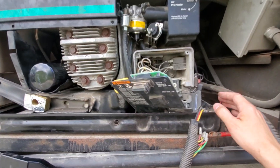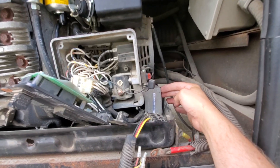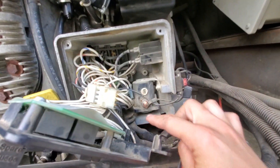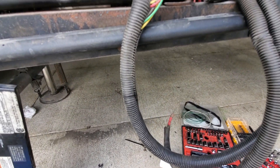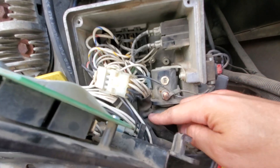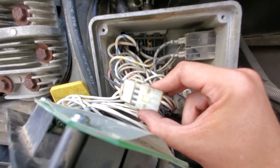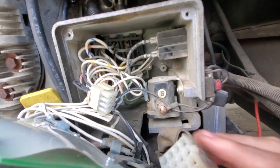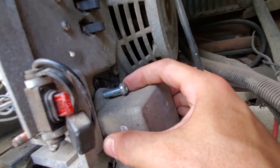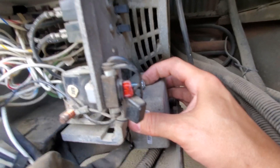The second thing is the voltage regulator. I did finally find a video from Flight Systems, who make a replacement, that showed the location of this. The simplest way to get this out — when you take this cover off, you're going to take the positive wires loose. You've got all these connections in here and a bunch of wires pushed up in this little groove. This connection here is our voltage regulator — I've already undone it a little bit just so I could pull it out. On the side where it's mounted, you have two screws, and they're both T30 Torx screws. This one's easy to get to — I can get my impact in there no problem.